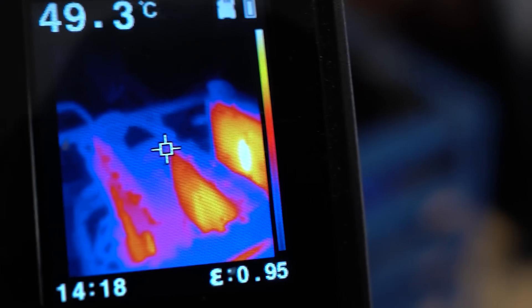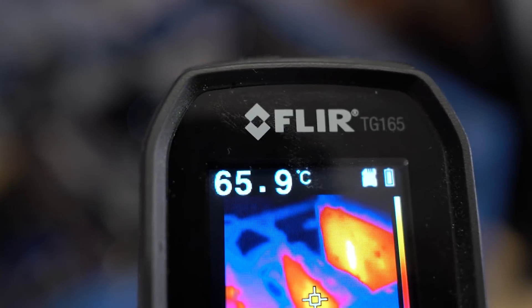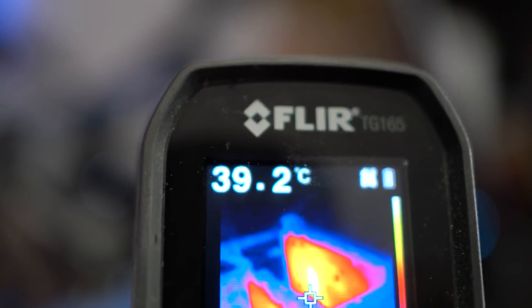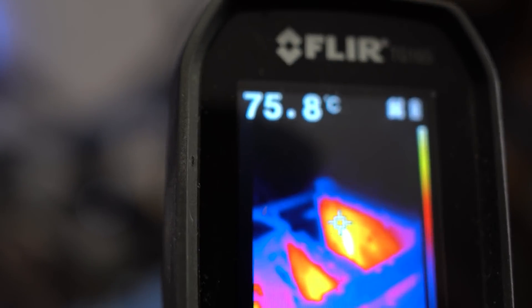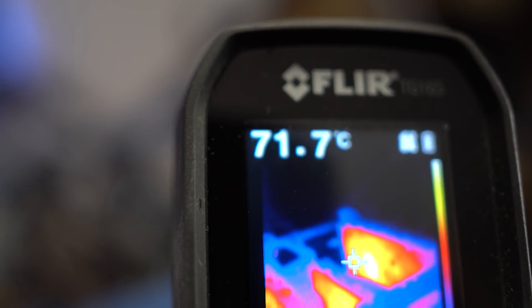Looking at thermals with the gun, that middle card is being cooked — confirming what Ray said. It is getting baked, about 75°C on that backplate. This rig was originally built for seven GTX 1060 3GB cards with very low heat generation, so you could pack them together. For RX 570s, it's a little close, so that middle card is getting baked. Switching the fan up to 100% gets temperatures down to around 65°C on that card, while everything else holds around 62°C at 30 megahash.